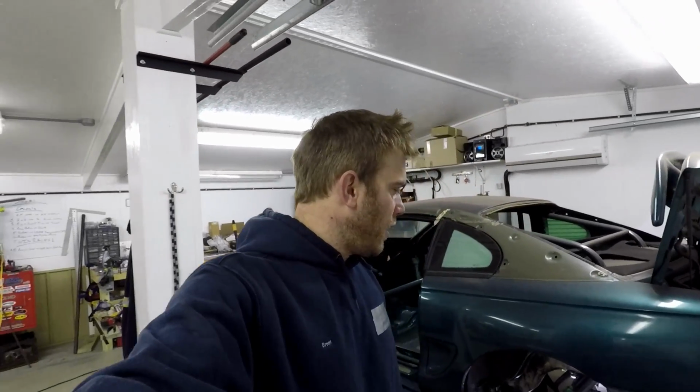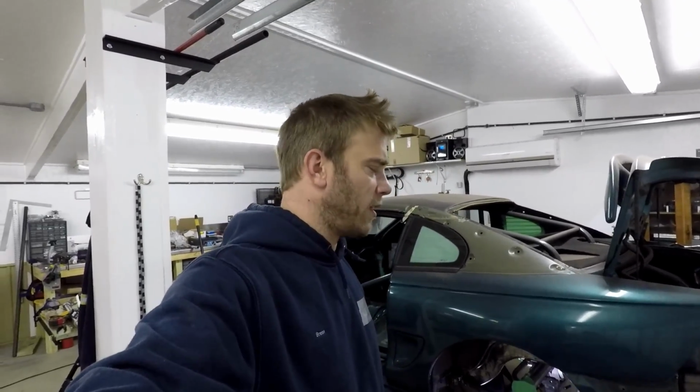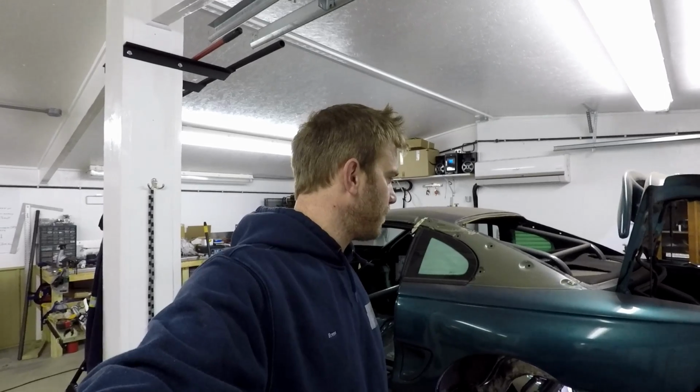But there's a few other things I still have to finish up, like those floorboards. I just hate MIG welding that stuff. TIG welding is so much more enjoyable on these old cars, as long as you've got clean metal. I did fight a few spots on the subframe when I was installing those torque boxes where I maybe should have used 70S-6 wire. I think it has more of the cleaner stuff, more silicon, which helps clean up the weld puddle.